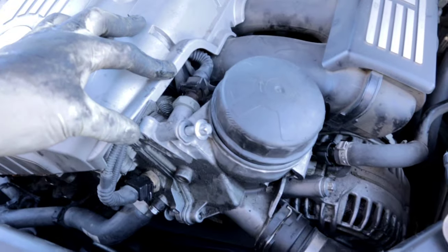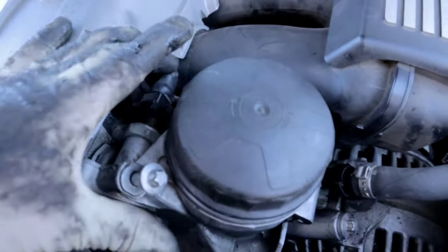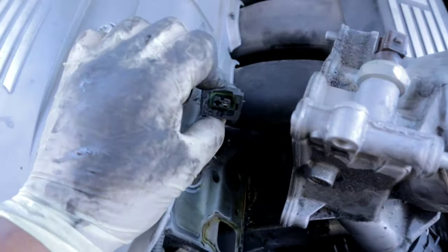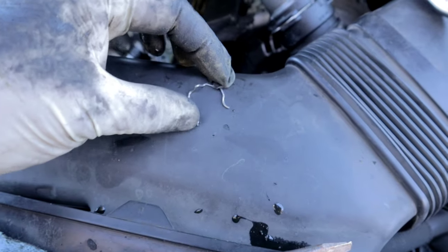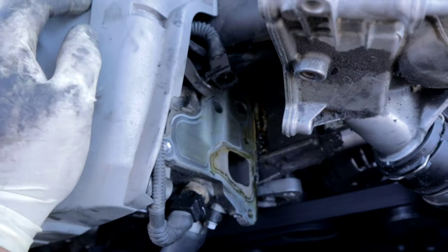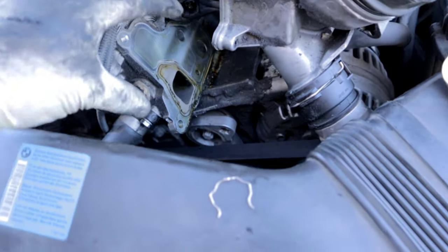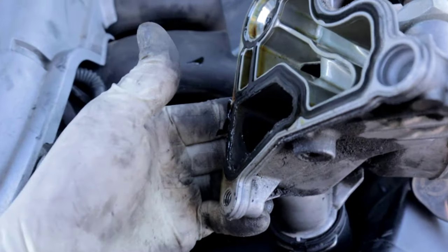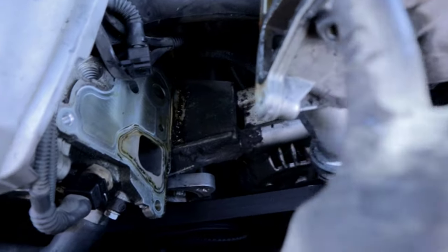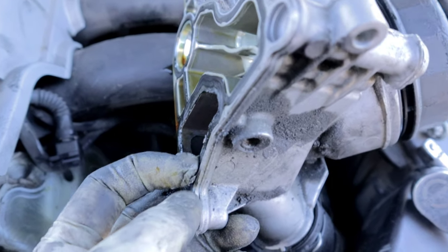Now I'm going to remove these fasteners, disconnect this sensor right here — I think that's the oil pressure sensor — so I don't damage it, then move the housing off to the side and remove the gasket. Once you remove those fasteners you'll be able to push the housing back. I disconnected the oil pressure switch — it's this little clip that secures it; just lift it up with a flathead and pull it out. You can see it doesn't make too much of a mess, which is why it's important to remove some coolant beforehand. Now clean the mating surfaces and remove the old gasket, replacing it with your brand new gasket. This old one is very flat — that's why we were leaking all that oil. I'll remove it with a small pick and install the fresh new gasket, and that should take care of our issue.